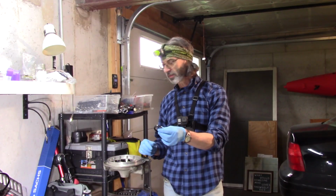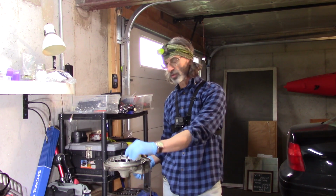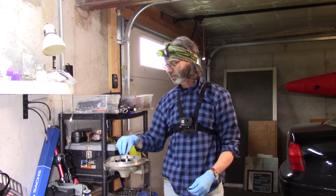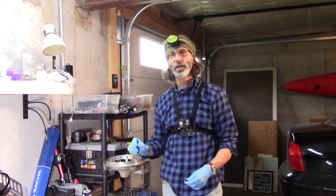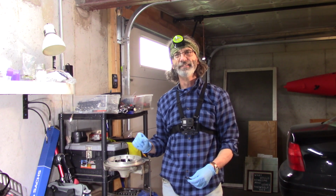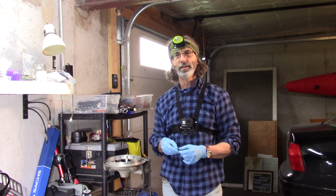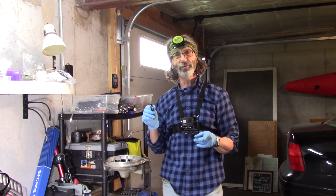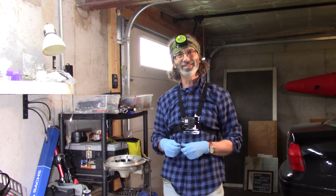Okay, we're back to the final drive. We've got the seal for the external on the outside here, and we're going to put that in. We're also going to put the roller bearing in on top of that, and then there's a sleeve that goes on top of that. And in my own defense, of all of the seals and all of the gaskets you watched us install, this is the only one I forgot. It was on a separate fiche, because I forgot it when I was looking at my RT. Ah, see, look at that. I've been excused.